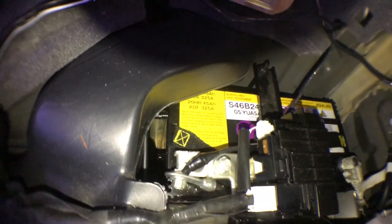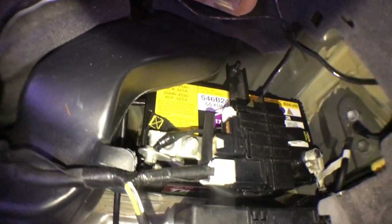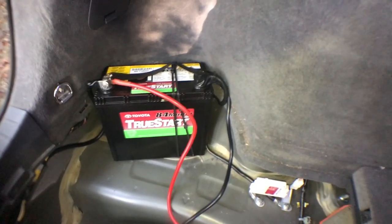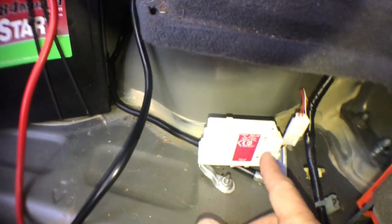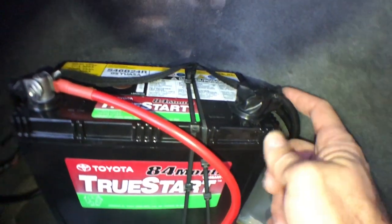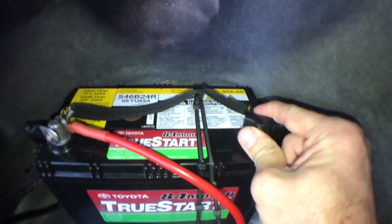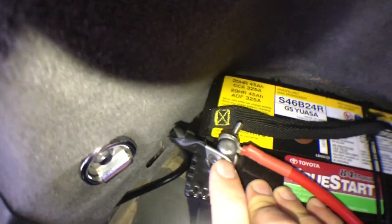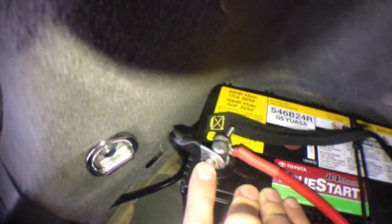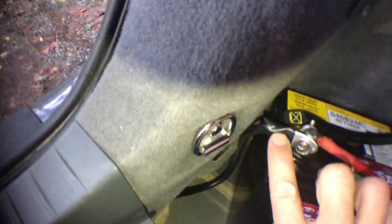After I put this battery in, I ran a ground wire. You don't have to run the ground wire to the battery — you can run it anywhere on the chassis. My ground wire tapped into a bolt here. I don't know exactly what it is, but I unscrewed that bolt, ran the wire up behind the battery, and it taps in on the back wire right here. Since I couldn't get those tiny connectors, I drilled a hole through this piece — it worked fine — and used stainless steel screws, lock nuts, and washers. The positive comes down out of here and runs down along the bottom.